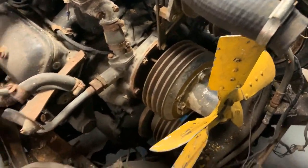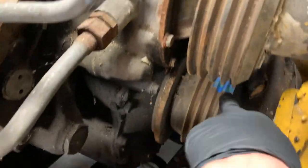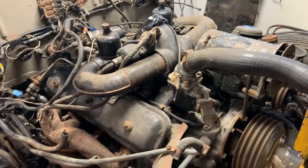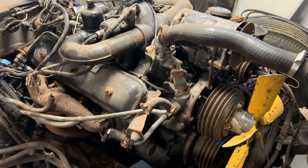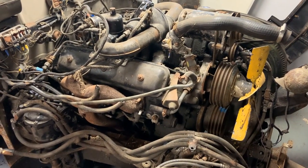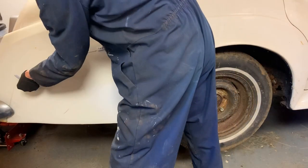With some decent gloves on, I actually managed to turn the engine over with the spark plugs out, which looks pretty good. I then put a bit more of the catalyst in and rotated it a couple of turns to smear it around, then put the spark plugs back in. Hopefully that'll be fine until we actually try to start it. Body-wise, there is a lot of plastic.